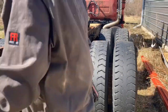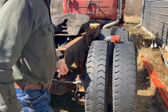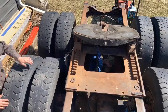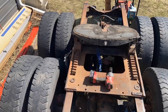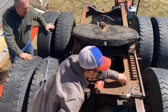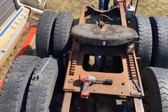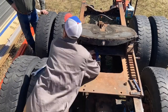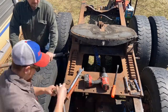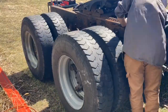Here I am driving out the bolts that hold the trunnion carrier in and the fifth wheel plate on. I was able to get the nuts all loose with that Milwaukee impact — pretty impressed with that. The stud I'm working on here actually holds the trunnion carrier in, holds the fifth wheel plate on, and it's the stud that sticks out that the shock mounts to.